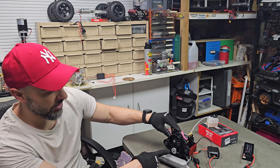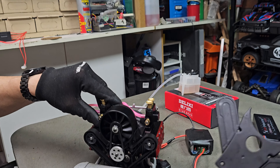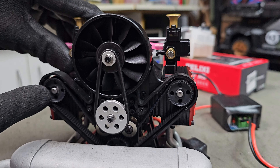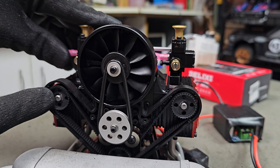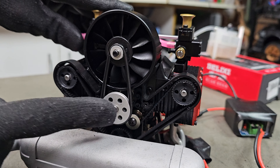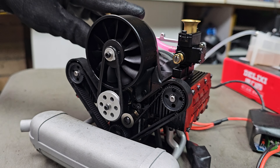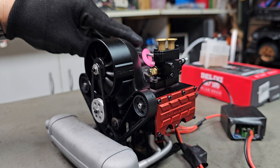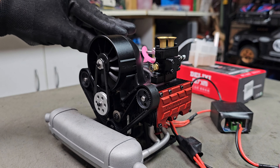I've taken off the cover here. You can see the belt plastic shroud. I just wanted to make sure the timing — that's going to make sure that these two timing marks are facing up. There's little dots, one up, one up, and the one on the crankshaft, which is behind this little pulley, it's facing that direction. Just wanted to make sure that it is, which it was, so double-checking that as well. My brother from another mother for showing me that as well.